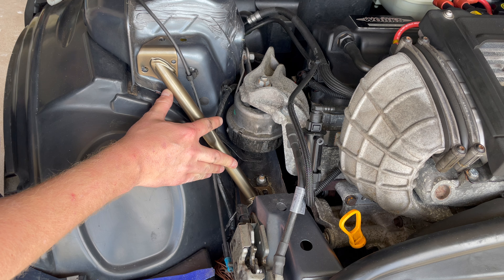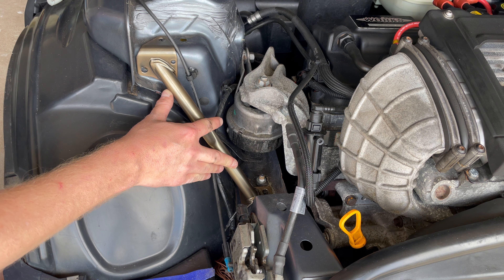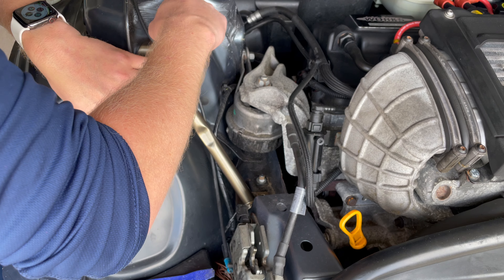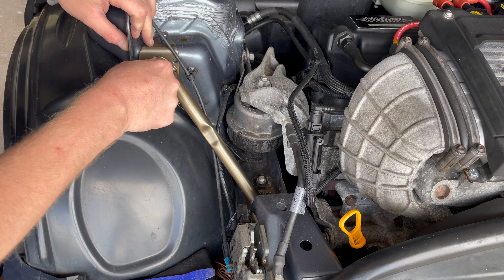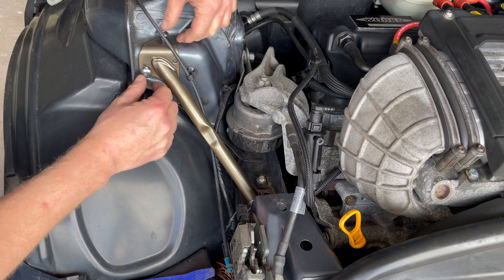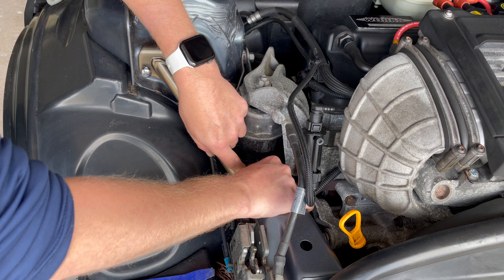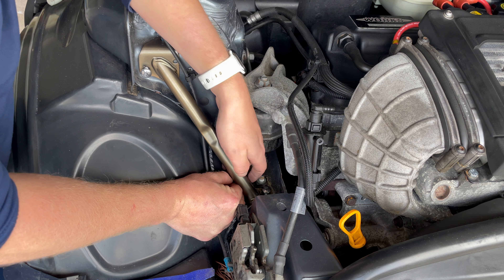It's whether you run these cables above or below — I think run below so it's nice and clear. Then all you need to do is grab your bolts, which you get with them. If you order from Mini brand new you can order the bolts; if you get it second hand off a car being broken, always ask them to supply the bolts. Just do them up by hand first. Because there's been a rubber bung in there it might be a bit dirty, so make sure they're actually going in properly before you start using a tool — you don't want to cross-thread anything. That's that one in.